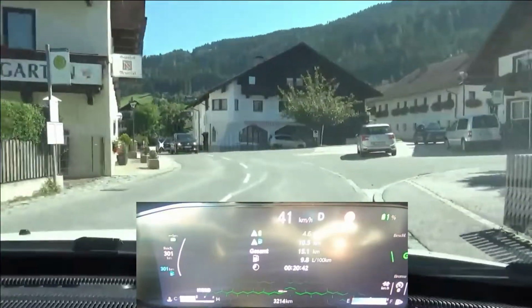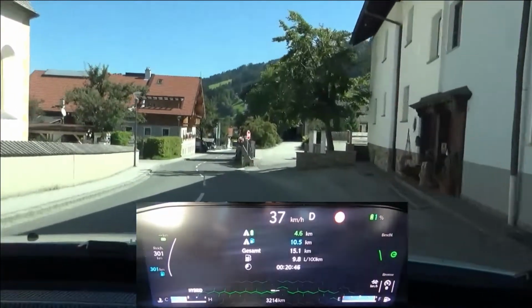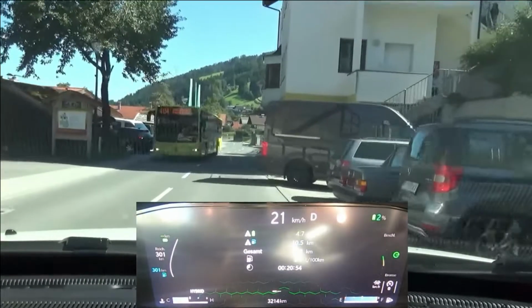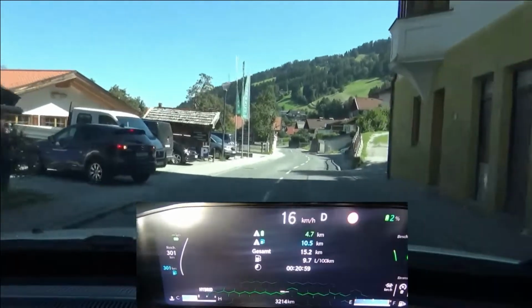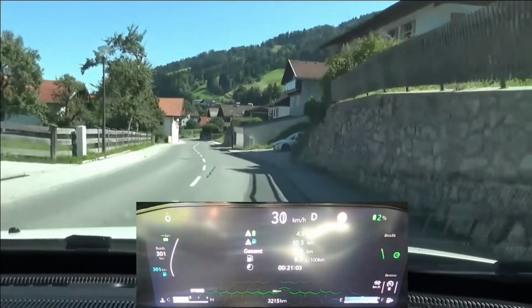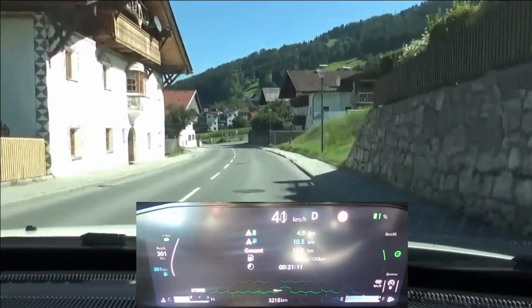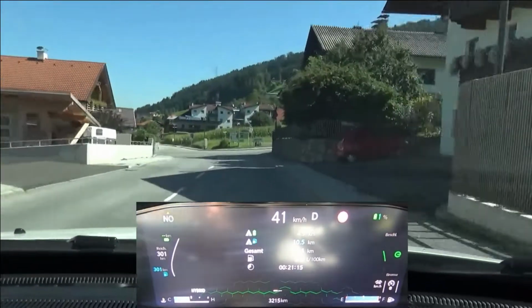half distance. However, one thing to keep in mind is that the electric motor, with its only 44 kilowatts, will not produce enough power to brake the vehicle electrically only. This motor will produce, I guess, 32 to 34 kilowatts of regenerative power, and that means that very often the friction brakes will have to be used by the car to brake. This means that we are not able to use all the potential braking energy and therefore have less distance for electric driving gained compared to plug-in hybrids with more powerful electric motors.